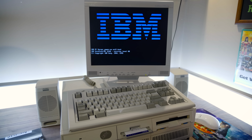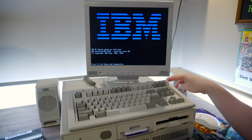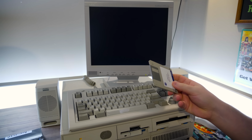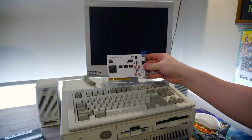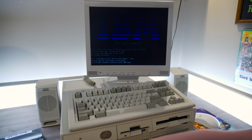Okay, PS2 Model 90 XP 486 DX2 going here. Cards already installed and configured actually, but we'll go ahead and start it up here and get it into the programs. We can go ahead and set up. We can check out some stuff. But I just copied over the ADF file, which you need in order to get these cards set up. Just standard operating procedure for PS2s with Microchannel. Much like the previous card from TexElec, this one needed an ADF as well. And so I just copied over the Sound Blaster version to here, and it's already on here.